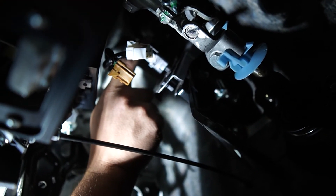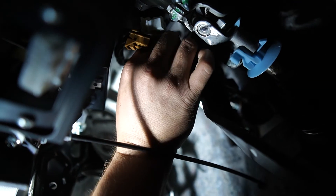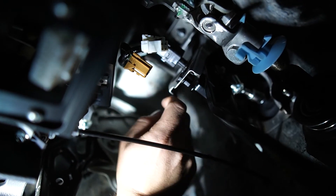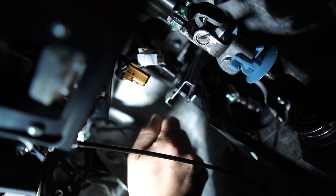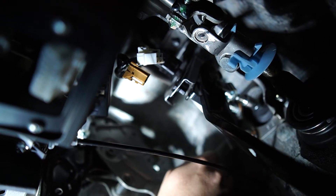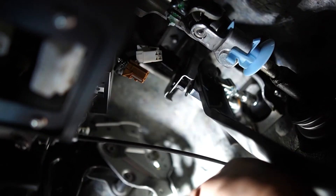When you put these back, you want to make sure that the plunger seats all the way against the brake pedal. Because if you just put it in place like that, the switch is never going to be activated by the pedal. So you want to make sure that's in there all the way and then twist it to lock. Same with the other switch. Then just put the plugs back.